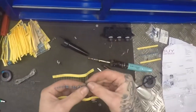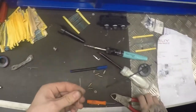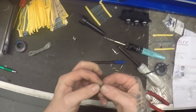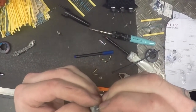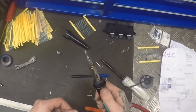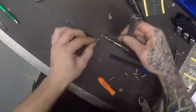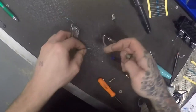Get yourself a 620 resistor, or if you've got 680s put 680s in. Chop that off a bit. These are a bit of a pain to do because the hole in there is actually smaller than the hole in the other one, so you might struggle getting two in. All I do is fire up your soldering iron, wrap it round. I'm just going to tin the ends of the resistor and the LED.